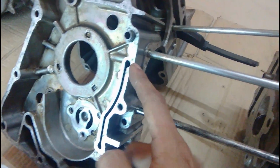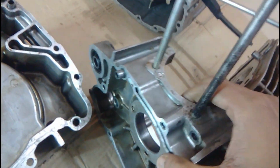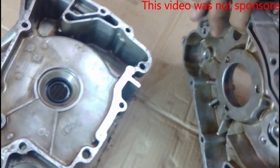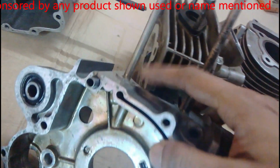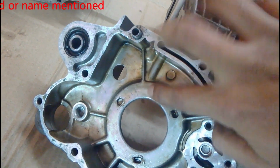and here it divides in two ways. One section travels to the camshaft, the blockhead. From here it travels around the bolt, the cavity where the bolt is fitted, and goes to the blockhead, and the other section of the oil travels downward towards the crankshaft, just opposite to the top hole. In the bottom you can see this is where the oil travels towards the bearing housing.